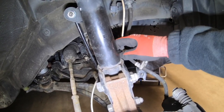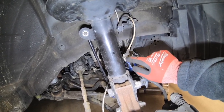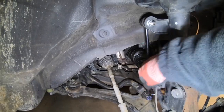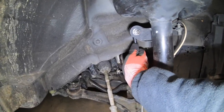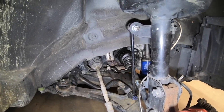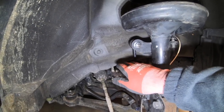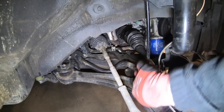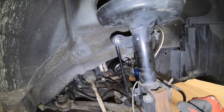Then there's a little clip — just squeeze it with your fingers or pliers. This is your ABS line; make sure to be really careful not to break these plastic clips because you'll need them reinstalled later. There's one more little clip to take off first. Then this here is your sway bar end link. The factory end link is longer than the one that comes with the kit, because when you lift, the suspension sits lower. If you leave the factory link, it can hit the lower control arm, so a shorter sway bar end link is included.